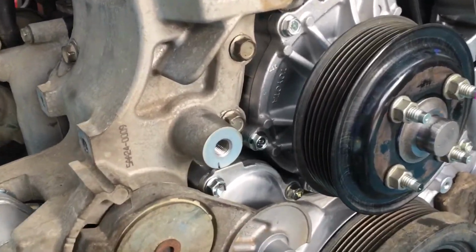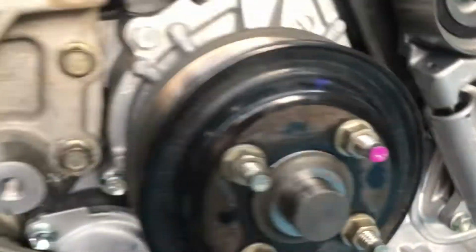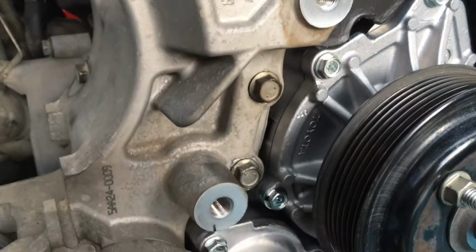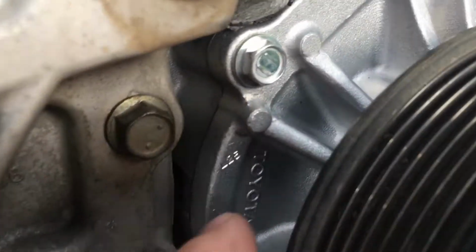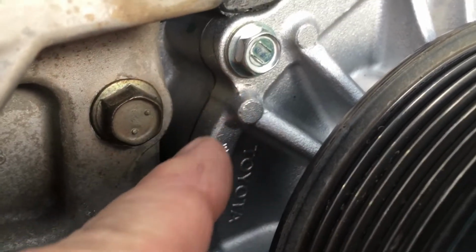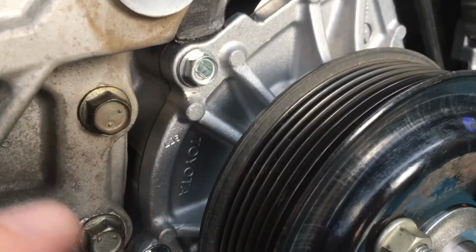If you want to have a look to work out whether you've got a one-piece pump or not, you should be able to look in here and see all these bolts, okay? 1, 2, 3, and they go all the way around, where you've got these bolts in place on a normal water pump. But I suppose the key thing, the most obvious way to look, is if you look in there, see that join there? There's like a join right at the end of my finger there. You need to have a look and see if that looks like 2 pieces of material joined with a gasket there. You could also look at the top section here. You can see that machine face in there. So this is obviously 2-piece. You won't see that gasket and that join if it's a 1-piece. It'll just be all molded as one part.